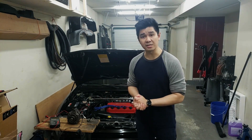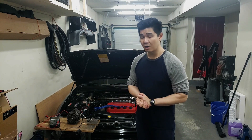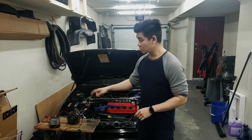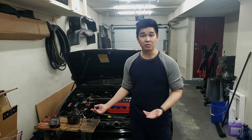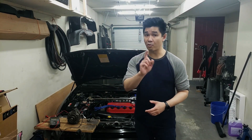One of the things you'll need is an impact gun or something to spin the alternator pulley. It has to spin fast enough so that it can generate enough voltage or amperage to do some charging. If it's too slow it's not going to charge, and that's not the fault of the alternator but more your equipment.